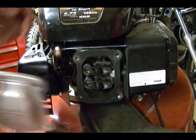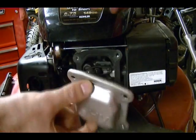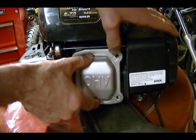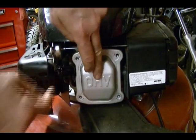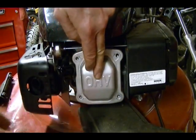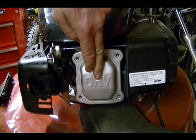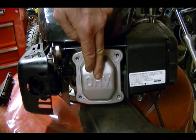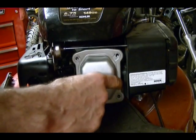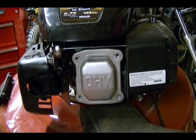When you reinstall your valve cover, Kohler always recommends that you replace the valve cover gasket whenever you remove it. When you tighten the bolts, do it in a cross pattern — one, two, three, four. The correct torque spec for the valve cover bolts is seventy-one inch pounds. If you've got any questions, leave them in the comments section and I'll do my best to answer them. Thanks for watching.